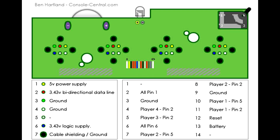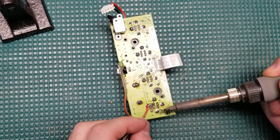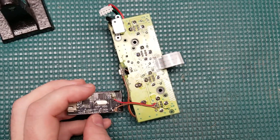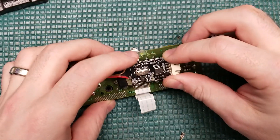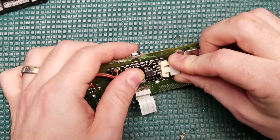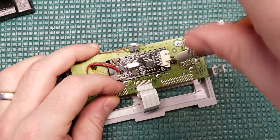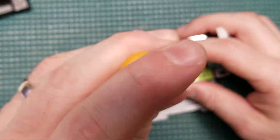What you're looking at here is the pinout of the GameCube daughter board for the controller ports. We need to note where 5 volts and ground are, because that's where we'll solder the LED controller. With the board all soldered in, the last thing I'm going to do is glue it to the back of the daughter board — making sure not to get it in the way of any screw ports or the large round pads along the bottom. I also put some electrical tape on the back of the LED controller board off camera to prevent any shorts. With that, we've done all the hard work — just button it up, plug in the LEDs, and it's time to test.